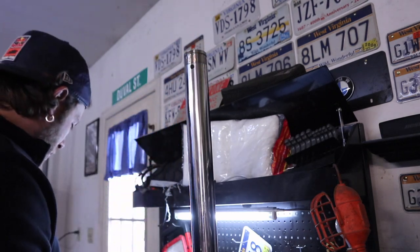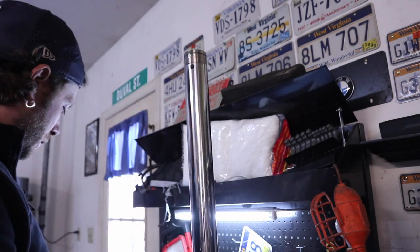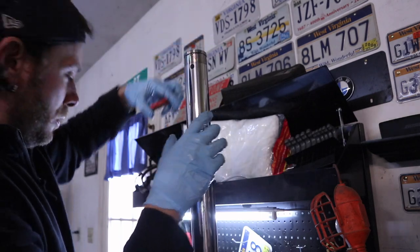We got the fork seal. And then we're gonna come down here and slide off the lock ring. And then finally, the dust boot. All right guys, so now that I have everything disassembled, I'm gonna go out in the driveway with some parts